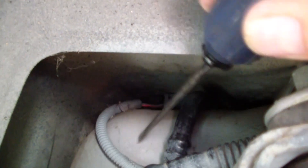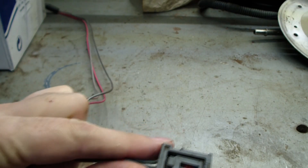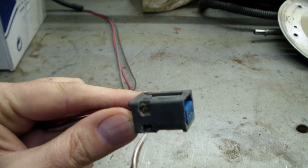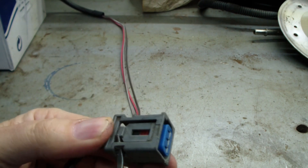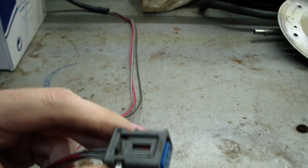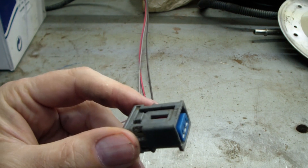Let's take a look in here. Here's the long cable that goes along, and the connector is right up here on top. The first little clip is right there, so my mission is to undo that clip and get it free. Then I can just cut the wire at the gas tank because I have a new sender unit. I finally got that stupid thing off — getting this cable off was no picnic, it took me a long, long time. Here's the trick: I had a nut pick, tried some other tools, but this one worked pretty well. I jammed it in there, pulled down the tab, then grabbed it and wiggled it back and forth to finally get it out. It was an hour-long job — I started to think maybe it would have been easier to just drop the gas tank.